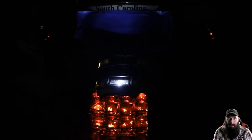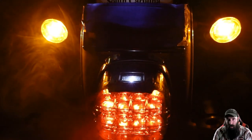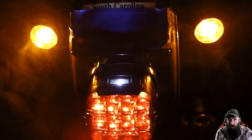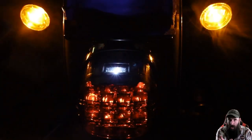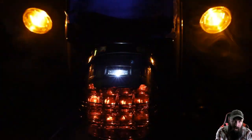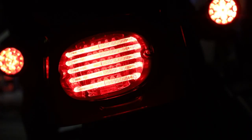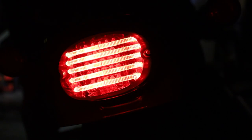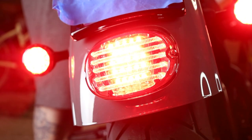I wanted to pop in right here and show you how dull the running lights are on the stock setup. I didn't realize how dull they really are until I put the Custom Dynamics on there. You can see those LEDs from Harley don't even compare. This is where your five tubes separated from your 25 LEDs really comes into play — you have five tubes for your running light and 25 LEDs for your brake light to give you that contrast. The difference is clear as day here with the stock versus the Custom Dynamics.